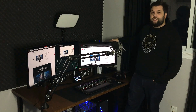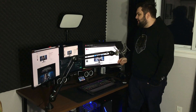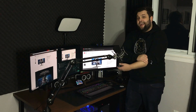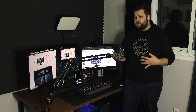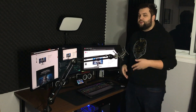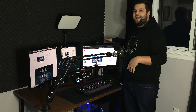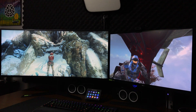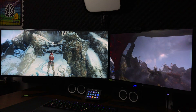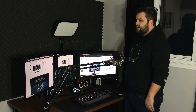I made a dedicated video just to this right here, which is the smaller 16 by nine 27 inch screen. It's an IPS panel, which is different from a regular panel. Most panels for gaming are TN panels. IPS panels work a little bit differently in the way they produce the image — what that allows them to do is produce more accurate colors, more vibrant colors, and have a wider viewing angle. So the image I get on this is a lot better. Typically what we would sacrifice with this type of panel was response time, but both of these offer a one millisecond response time.